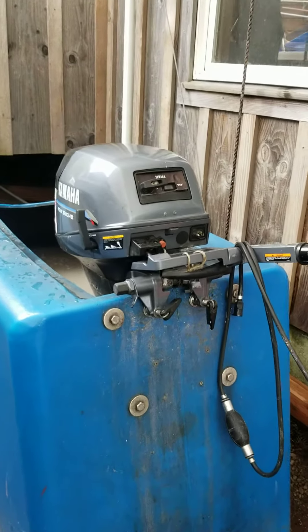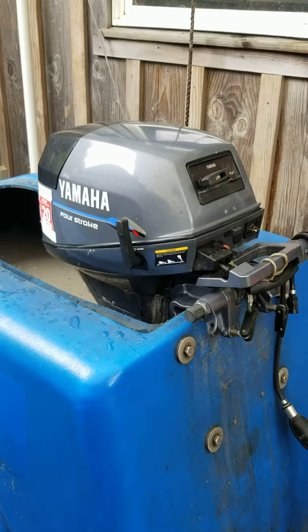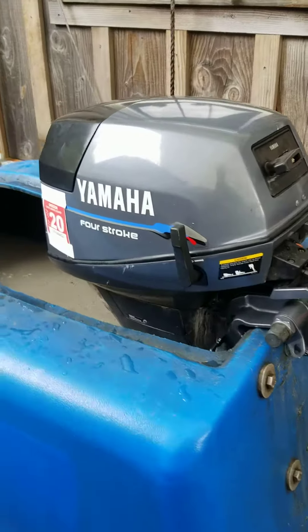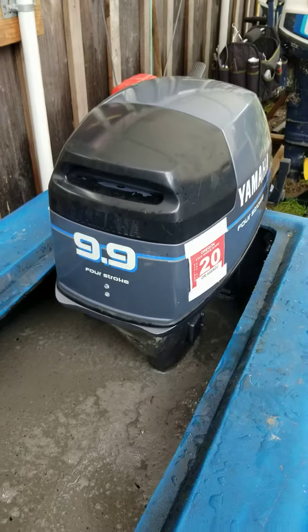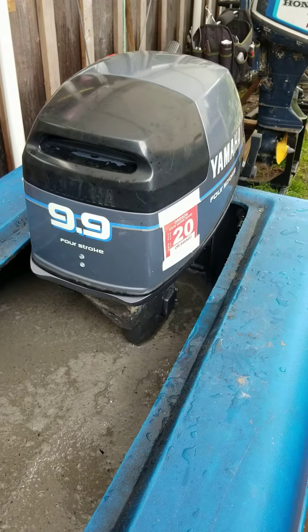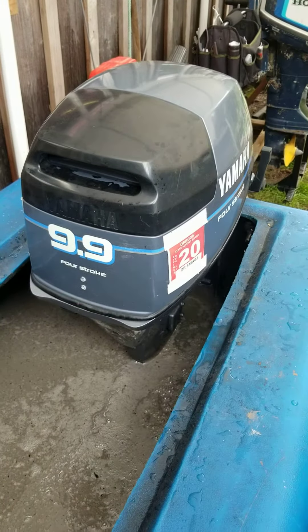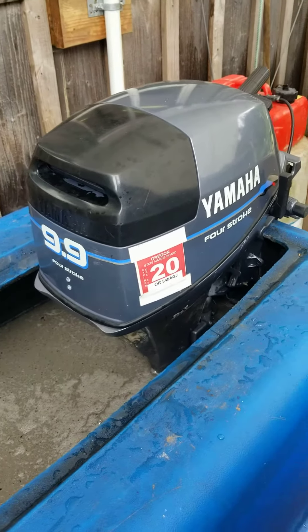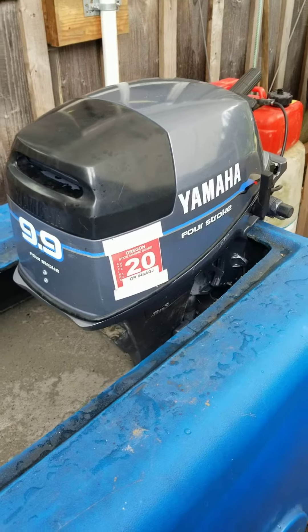Hey Dan, Brandon at Platypus Motors. I just want to send you a quick video on your motor, just in case we don't get it in the tank when you pick it up in a day or so. What we found was the needle and seat — the needle was worn, so I replaced that with a new one. Then I went ahead and went through the carb again, and it looks like it probably had some stuff still stuck in there. That's not uncommon with these old carbs, because they have such small orifices that get clogged up.